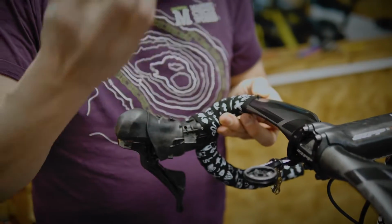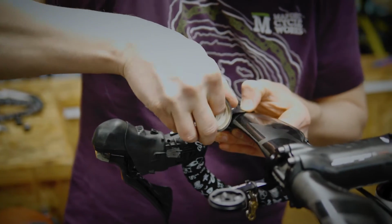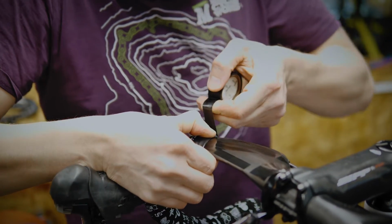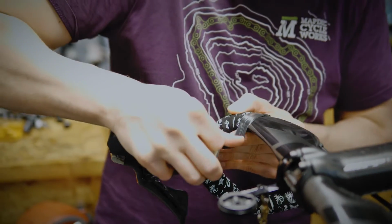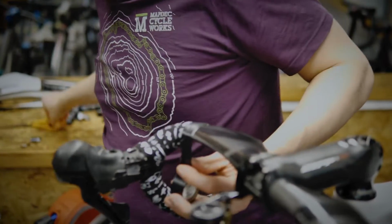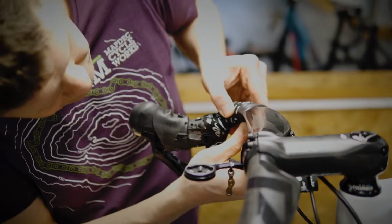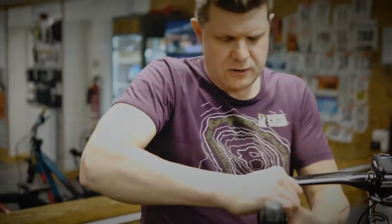Now your electrical tape is going to go the same direction as your bar tape, and it is going to be exactly lined up with that edge, not overlapping here. We want a nice smooth finish. Look how tight I'm pulling that, it's almost stretching the electrical tape. Keep that edge razor sharp, no wrinkles. 3 wraps should be enough, and we're going to cut it so that the joint is going to be underneath. Just like that. Just rotating that and make sure we've got good contact.